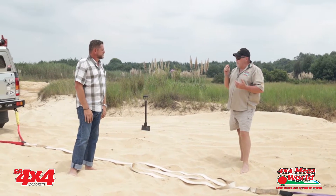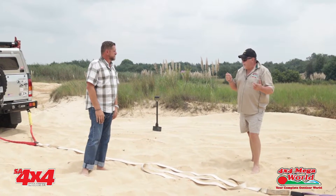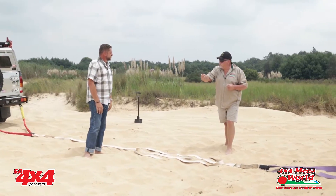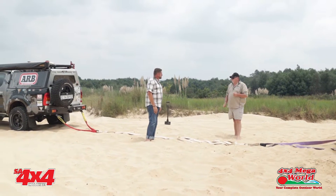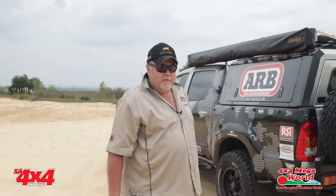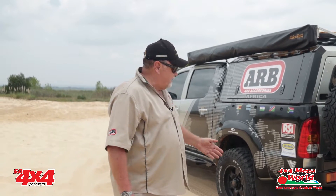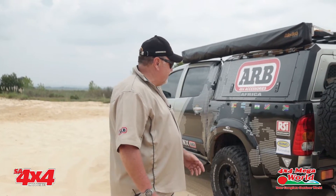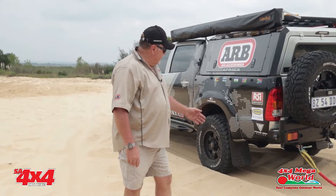I'm not going to give you a violent pull — just a slight tug. Let's see what the car does. If it moves, I know it's not seriously stuck. If it stays, I need to come back with a little more momentum. Note I'm not saying speed — the moment I say speed, people think fast. You're always as slow as possible, as fast as necessary. In preparation I've built a bit of a track and compacted the sand to give myself a solid base. The sand is soft and it's the hottest part of the day so traction is an issue. I've also already gone to low range, so I'm going to use second gear, low range.